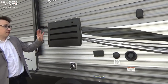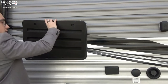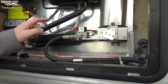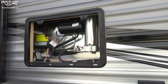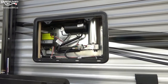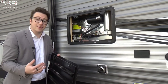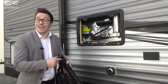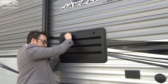Going along the side, I'll touch on the fridge compartment. You want to make sure there is a white drip line either in the drip tray or leading outside through the grates, so condensation drips outside or evaporates with the heat of the fridge. Another thing to consider — you may want to put little mesh strips over the holes here, as bees like to make nests in warm areas; mesh strips stop them from getting in.